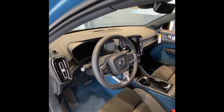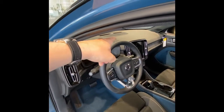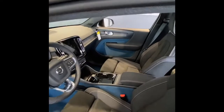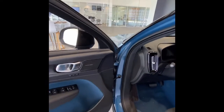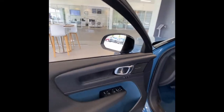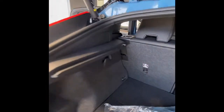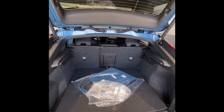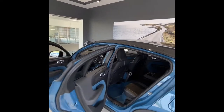For the last thing about the interior - all Ultimates have the Harman Kardon stereo as standard. We have a full range up there doing highs and lows in the dashboard. Buried under the passenger seat is an all-digital 600-watt amp powering all these speakers. In the driver's door panel we have a tweeter. In the rear door panels, a mid-range down low and another tweeter up high. In the cargo compartment, two more mid-ranges. Under the dash is an airwoofer that uses the entire inside of the car as the enclosure, giving you really awesome bass performance.